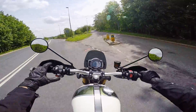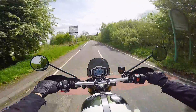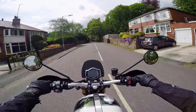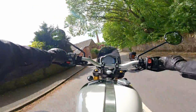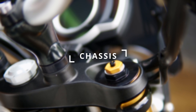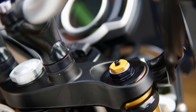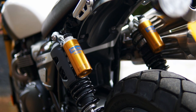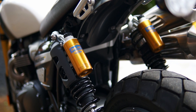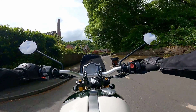The smoothness continues as you glide over bumps. The premium suspension is faultless, and on this particular bike, set very soft for a lazy and laid-back ride. I'm definitely not that kind of rider, so I would tighten it all up straight away. The XE lets you do just that with ease, thanks to the 47mm fully adjustable Showa forks that offer 250mm travel at the front, while at the back there's a set of fully adjustable Öhlins twin shocks with 250mm travel. This is serious stuff for off-road riders.